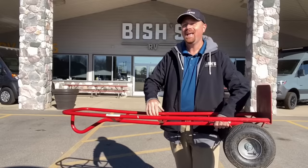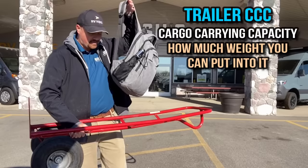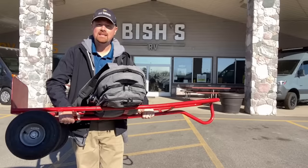The GVW is a very important number because if you make sure you can always handle the GVW of the trailer, you're never going to be overloaded. With those two pieces of information we can get the CCC — cargo carrying capacity — which is basically GVW maximum weight minus the empty weight: how much stuff you can put in it before it gets overloaded.